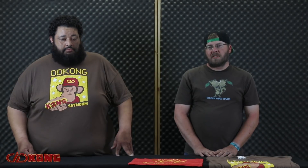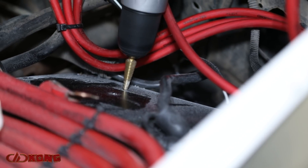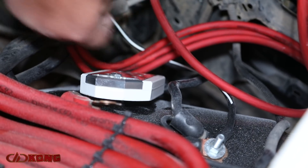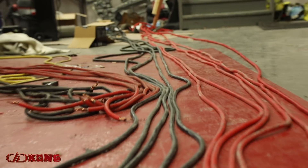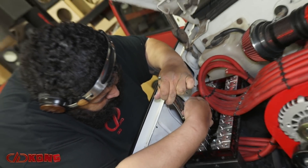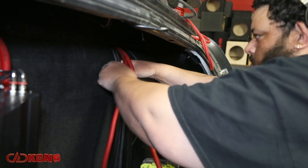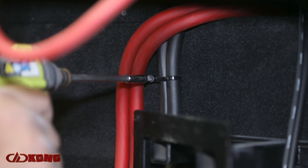We had some clearance issues. We had to modify the exhaust slightly, remake the intake, did the battery delete — which Jake 3D printed — so we could put our distribution to still power the stuff that makes the truck actually run. When you're trying to stuff 24 runs of zero gauge down the side of a vehicle, you got to get creative. Spent lots of time under that truck. Everything went back together after I got the fuse holders from 12-Volt Metalworks. Sometimes it takes zip ties, sometimes it takes bracketry. There's a lot of tucking and a lot of pulling and a lot of teamwork that made that happen and got the power from where it starts to where it gets used.